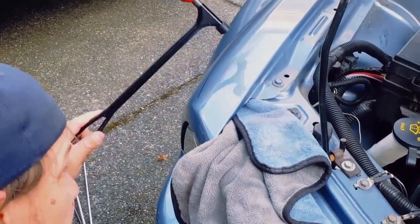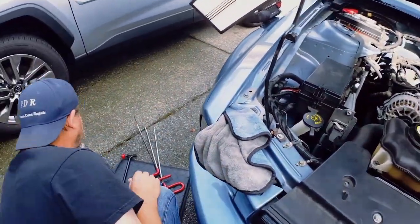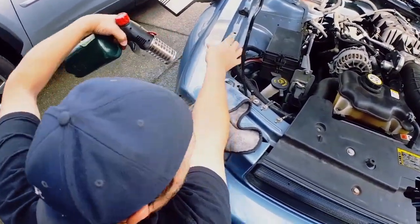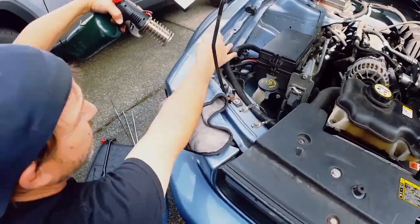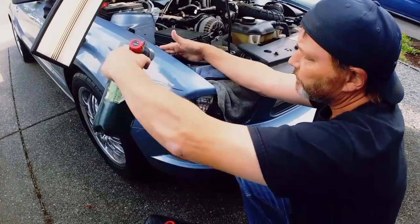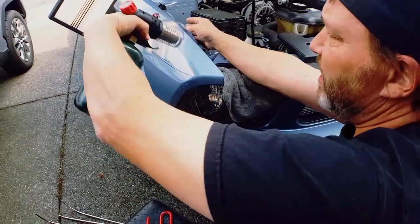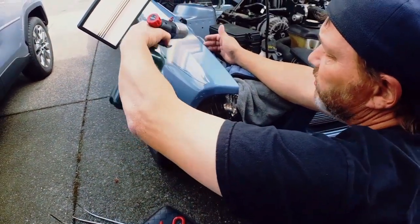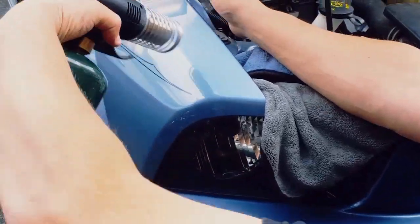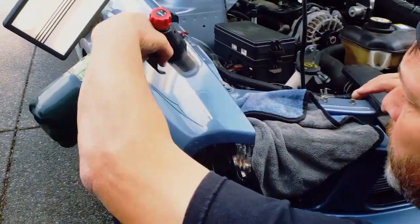I got that brow down a little bit. I want to get it a little warmer — I'd say it's about 60 degrees to the touch and I want to get it easily up to 80 or 90. This propane heat gun is real forgiving — takes a long time to heat up. It's not wimpy, but it's not like a normal heat gun; if I held a normal one this close this long it would have a chance to burn the paint. This one just gets it nice and warm.